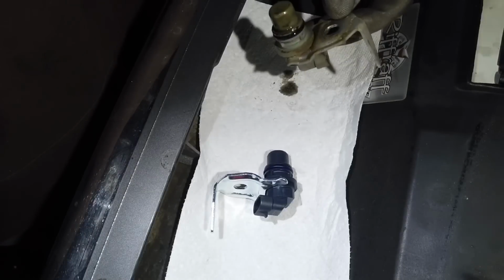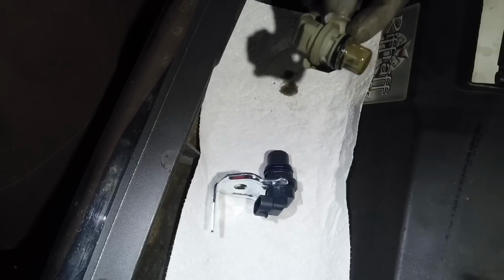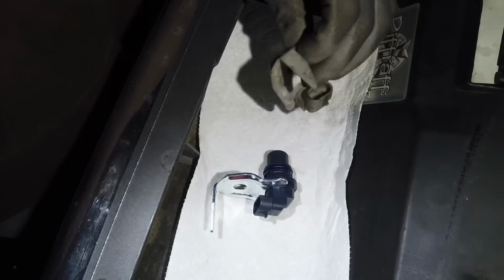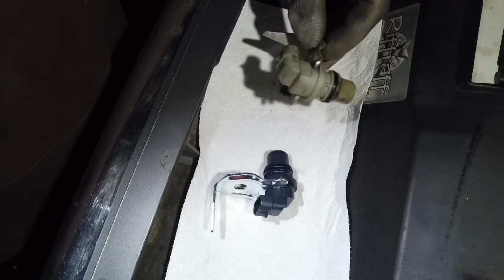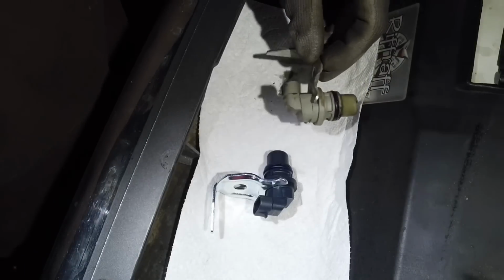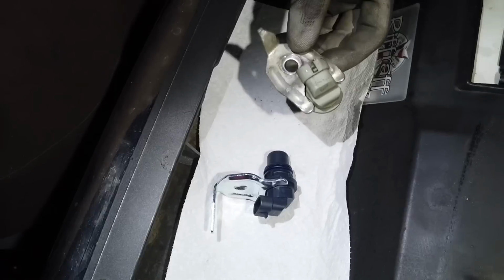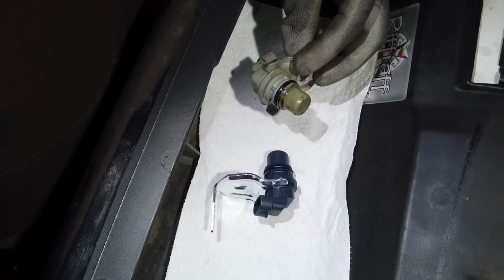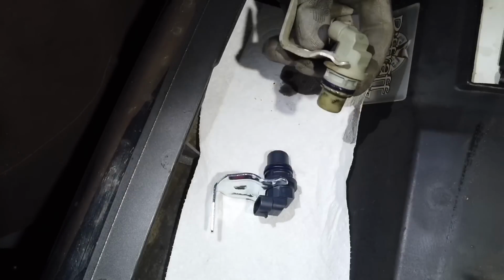Now the black one has a larger diameter magnetic pickup area, and the new one, which is this gray one, was soon found to have deficiencies that many owners found less than desirable. On many trucks there was a noticeable miss at idle, and also because of this gray one, many injectors were misdiagnosed and replaced when there was a code found. So basically this silver one is not really that much better than the black one, but I'm guessing there were fewer shutoffs, so the black one maybe had more safety issues than this one, but still it's not really that much of an improvement.